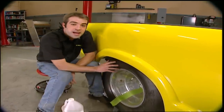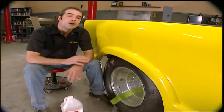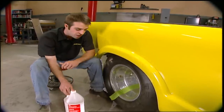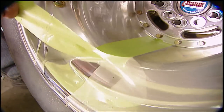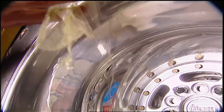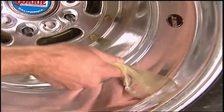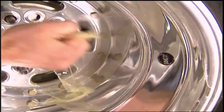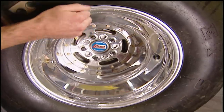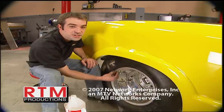Here's a handy tip: when we had this truck in the paint booth we had the tires and wheels wrapped in paper and masked off, but overspray gets everywhere. So cover the tires and wheels in paint booth coating. The booth coating gets sprayed on with a regular paint gun, and after it dries it forms a barrier between the overspray and your painted, chromed, or aluminum pieces. It just takes one wet coat and about five minutes to dry, and then the overspray sticks to the coating instead of your parts. Removal is just as easy — you can peel it off or hose it off with water in just a few minutes. That ought to really save you some time with the polishing cloth. Thanks for watching Trucks — we'll see you guys next week.